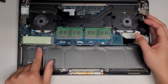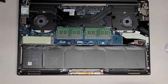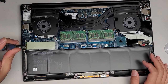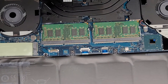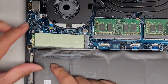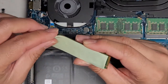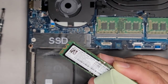There's an M.2 PCIe NVMe SSD here. If you're going to remove that, you want to use a PH1 or JIS1 screwdriver. There's one screw here holding the SSD into place. Once you remove the screw, the SSD pops up slightly; then you can grab it, wiggle it, and pull it back. Here you can see they put a thermal pad on here — if you get a new SSD, you can move this thermal pad to the new one. It's an M.2 PCIe NVMe SSD.